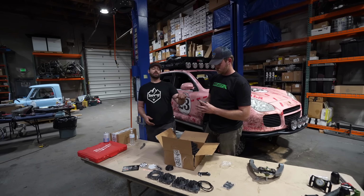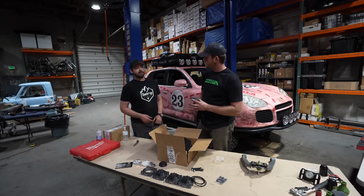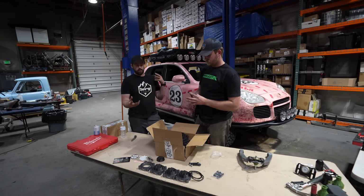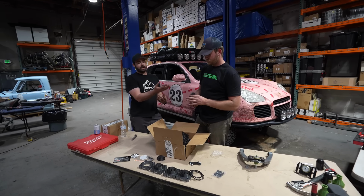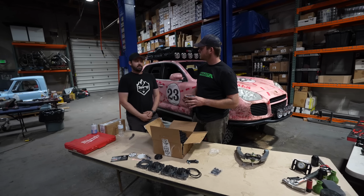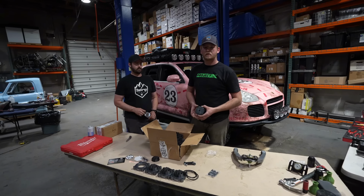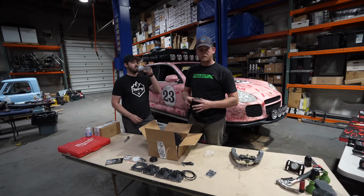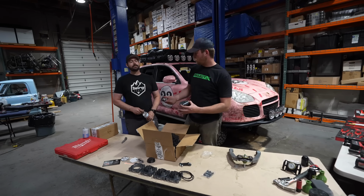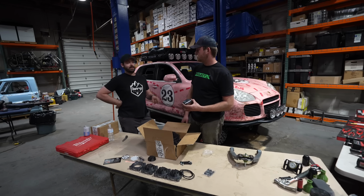So what's also cool about this subframe spacer is that it's got an integrated subframe centering sleeve in the actual spacer itself. So no need to do 2 pieces. It not only spaces a subframe, but it'll keep it centered and keep it from shifting. Existing issue, if you use your car enough off-road and don't really maintain or look after it, your subframe bushings can fail in a way that your subframe falls out from underneath the car. Does this hold the subframe in? So there is another design feature incorporated in that, which I'm glad you brought up.